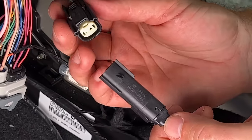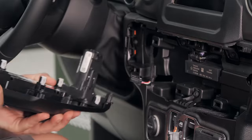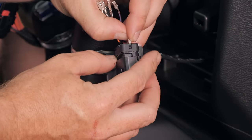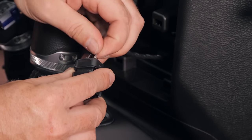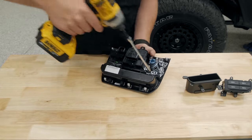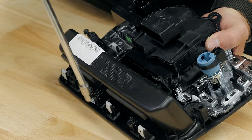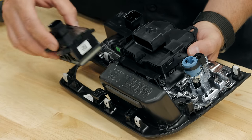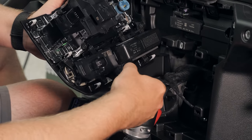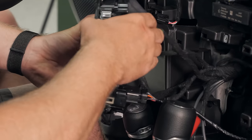Once you have that snapped into place, the orange wire that we just removed from that factory connector will be pinned into one of the supplied connectors along with the additional orange wire also in that auxiliary switch harness. Once we have those connectors assembled, we can connect them together and then continue fishing our wiring through the dash. We'll need to remove the climate control panel as well as the center lower dash panel so that we can get access behind there, pull the auxiliary switch wiring up through the center of the dash, and insert the bare pinned wires into that supplied auxiliary switch connector following the provided instructions. Then we need to remove the cubby from that center lower dash panel, flip it over, remove the five-and-a-half millimeter screws holding it in place, and replace it with the provided smaller storage pocket along with the auxiliary switch panel. Those secure back in place with those same screws. Then we can make the connection on the back side of our auxiliary switch panel with that wiring we just completed, connecting all our other existing wiring, and reassemble that center dash portion.